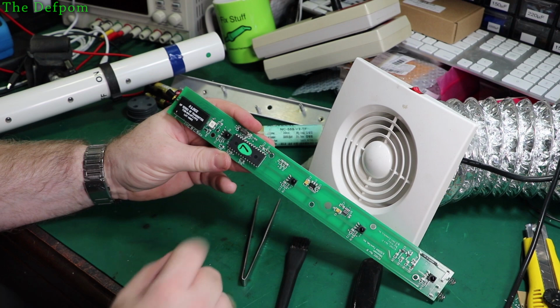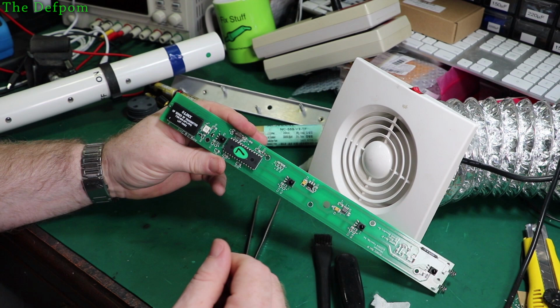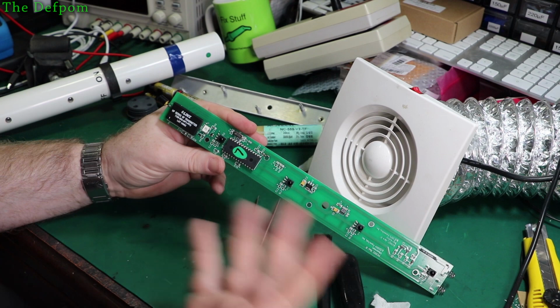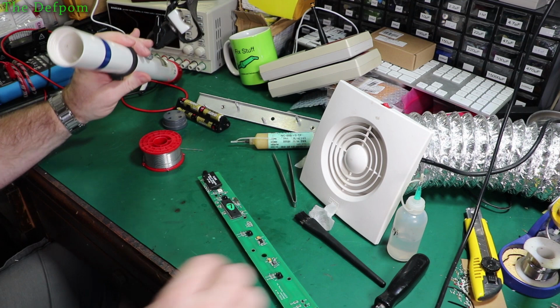This also, you can see this is a Microchip PIC, 16C57C, I think it says. I'm not a PIC person, I've never used PICs, it's just not something I've done. I suppose I've missed out a bit there, really, but as far as understanding what this particular thing's doing, it's using a pulsed encoded light for each one, I'm guessing. I could actually check that, but I'm not going to do that. And then that's controlling this thing here, which is reprogramming the frequency it's using, that sort of stuff. The other version of these I pulled apart also had a PIC in there, but they had a different transmitter system. They used like a LoRa module type thing. So that's very different.